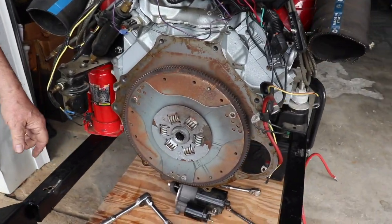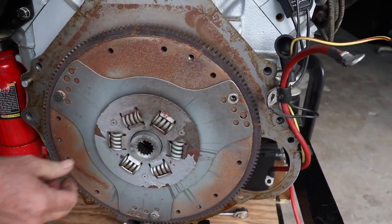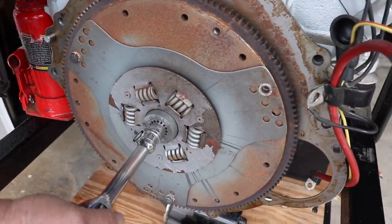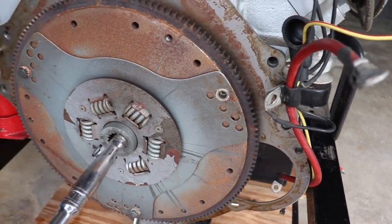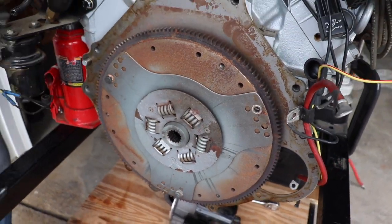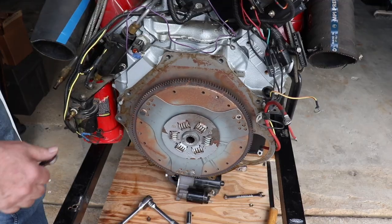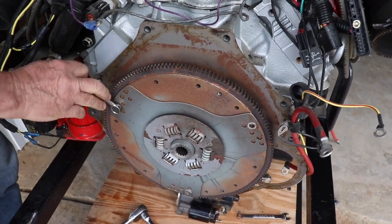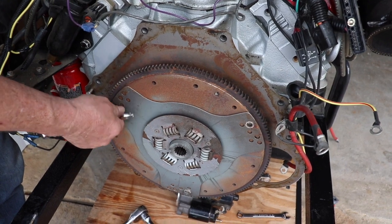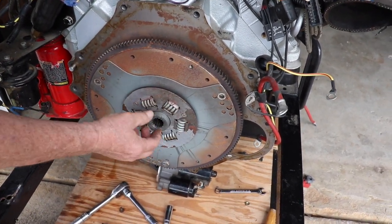Okay, now we're ready to pull the bell housing — that bell housing has to be pulled straight back because of the locating pins, which make it easier to get everything lined up. And there's our flywheel and our damper plate. You can check these springs — these are all pretty tight, so that tells me there's not a lot of wear on this plate. I like to take something to stick inside the center hub and move it around. There's a bolt missing here, that's why it's flexing a little, but the hub itself is nice and solid. These bolts are actually 9/16-inch and the torque on these is about 18 to 26 foot-pounds.